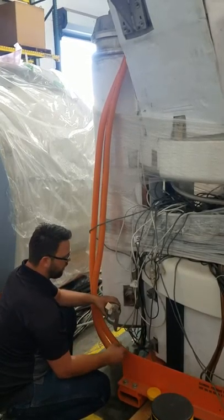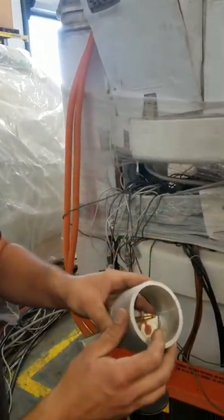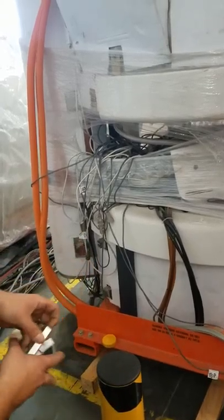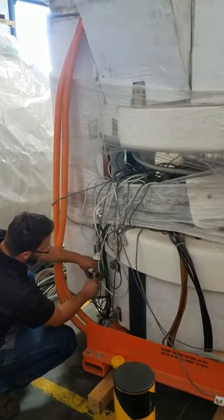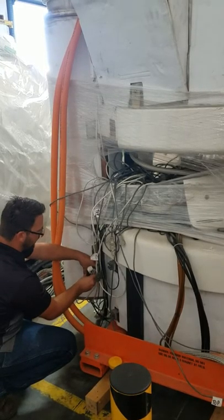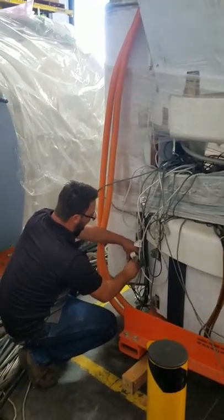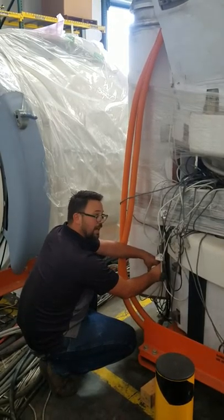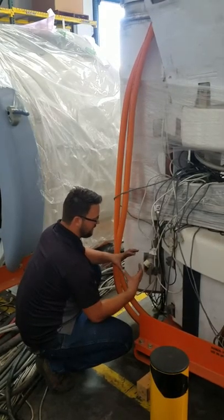Basically it's all threads with a purchase point at the end of it, so you pull that all the way back. Put your actuator, flip it over your vacuum port, push down on your actuator. I like to go counter clockwise to jump the thread, then go clockwise a couple turns. Give it a nice pull and make sure you've got a good hold on the vacuum plug — that's exactly all it is. It's a plug with an O-ring around the side.